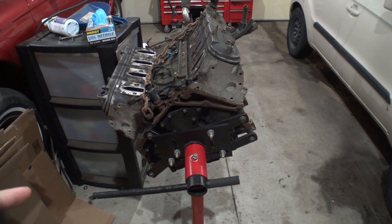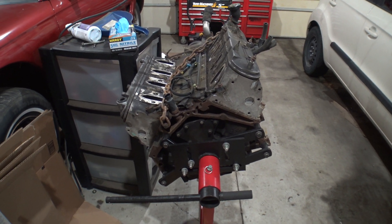A lot of you were asking about the steam vents. This engine has the four-port steam vent. I've done tests where we've eliminated them completely, and we've done tests where the newer engines are the front only — and I see no difference. I really fail to see how that's going to blow your engine. I've done a few with 800-plus horsepower on pump fuel with all four blocked. Basically, what I usually do is whatever it comes with, I use. Some people say you're using all four steam vents — that's how they're staying alive. Not really. That's what I got with the engine and it was easier to bolt all that stuff back on.